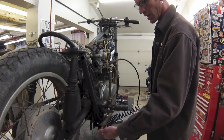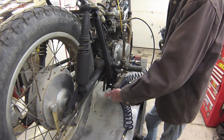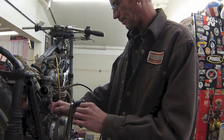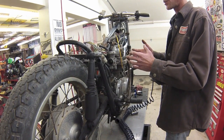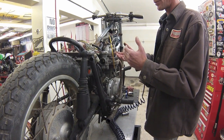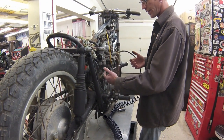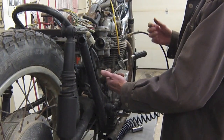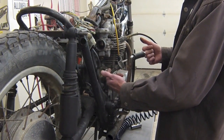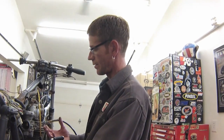Then we'll go down here and do the same with the exhaust. If air was leaking past the exhaust valve and seat, I would be feeling air here. Now we're going to check the crankcase. If this were like a Harley or a V-twin, you'd go to the head breather or oil tank to see if there was any air there. Immediately right there — that is where my air is coming from. So that tells me piston bore, rings, pistons — something's worn in there and it's blowing air by and through.